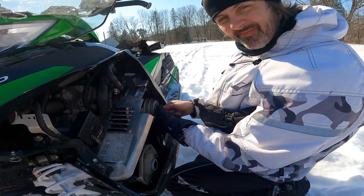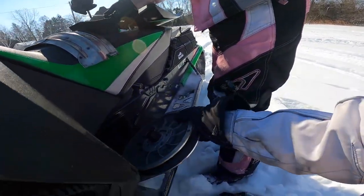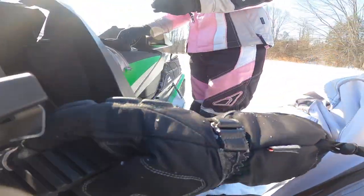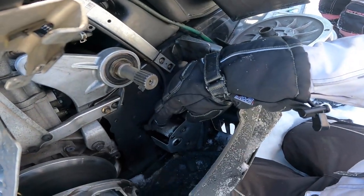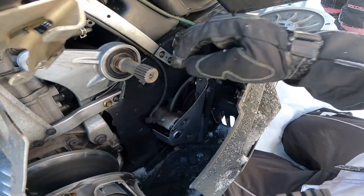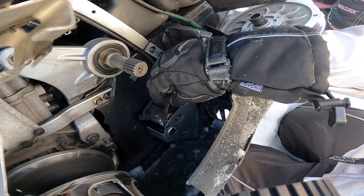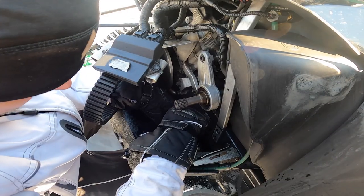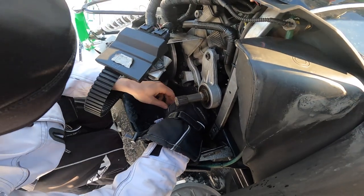So, don't know. All right, so we took the secondary off and the belt sort of off and the belt shield to try to get better access to this bleeder valve here so that I can use this same wrench and round off the other two corners. Wait, no, it opened it. It opened it. Okay, cool. Sweet.